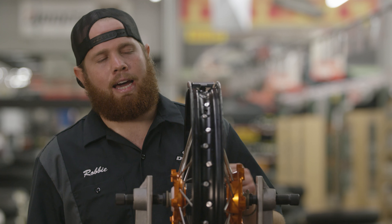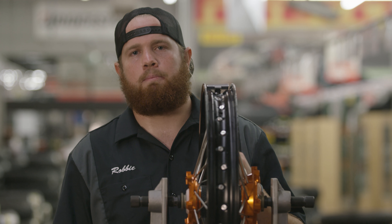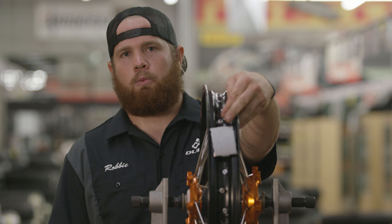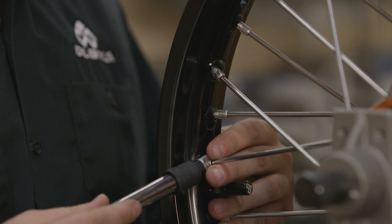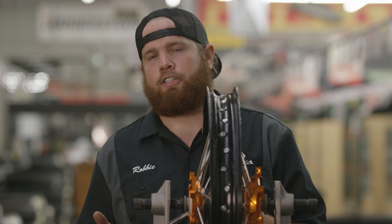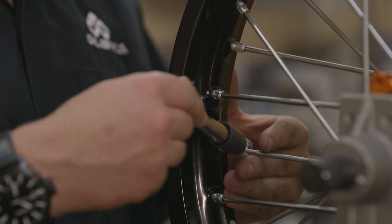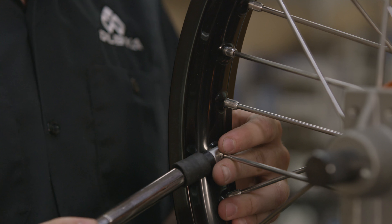After you've checked your wheel and made sure everything's good on it, nothing's majorly wrong, you're going to want to get it into a stand. If you don't have a stand, you could do this process with the wheel in the swing arm or in the forks in the front — it works just fine. We have a stand here, so get it snugged up. As far as tightening goes, you want to start at either the rim lock or the valve stem — something you can identify as your starting and ending point so you know exactly how many times you've gone around the wheel. For this one, I'll start just above our rim lock.